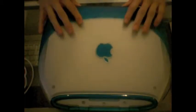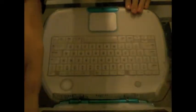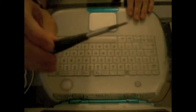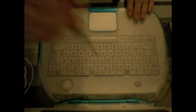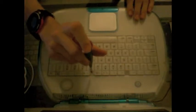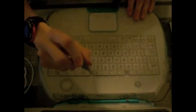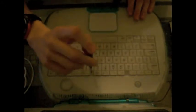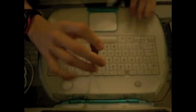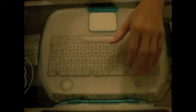We're back on this side. Take the battery out and go ahead and open it up. You're going to want to take the screwdriver with a flat tip and put it between the F4 and the F5 key. There is a little screw in here, and you want to rotate that to the unlock position. You'll feel the keyboard kind of shift down whenever you get it — just rotate left and you'll feel it kick down.